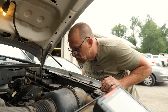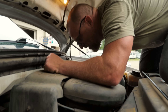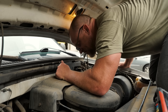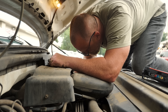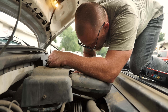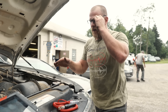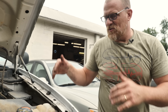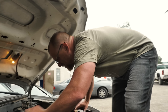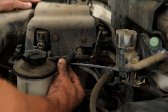I'm interested to see if there's any visual. Wait — I hear something. I can hear arcing. I'm going to get my mic close. What I'm hearing is a spark issue. I hear an audible cracking. Now this is one where I could definitely get bit, so I'm going to shut this off because I'm going to put my hands around where number six is — second one in on this side, which is buried. I heard it arcing.